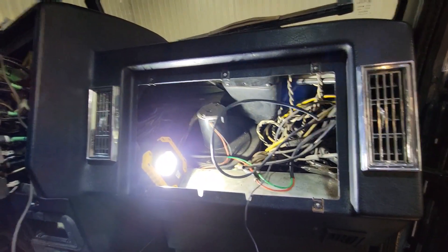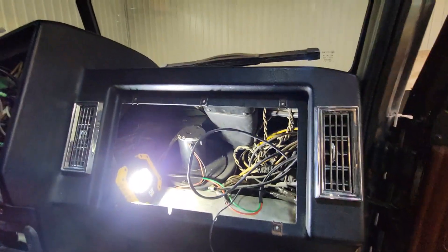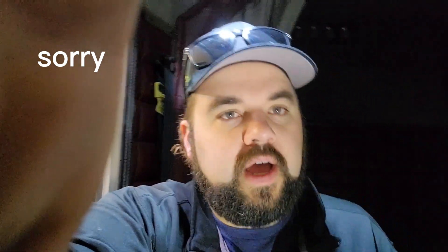One of the issues with LED lights in these big older trucks is that they don't have enough resistance on the wire to make the relays work properly. There are special digital relays you can put in, or sometimes if you get enough LEDs working together they'll work. I do have a digital relay in there, but with just one marker light it's not flashing yet. If you touch a test light to it, it flashes fine because the test light has an incandescent bulb and makes it work the way you'd like.